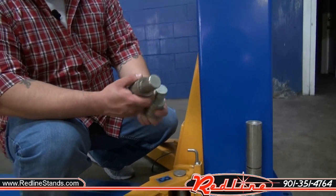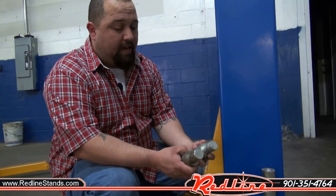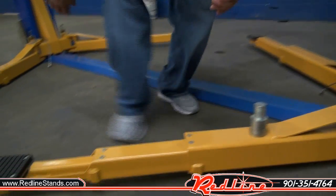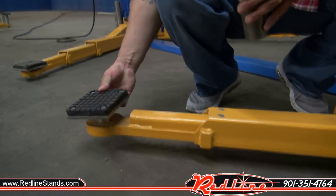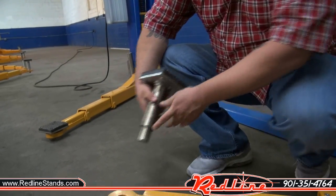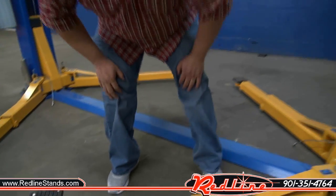These are great for if you have a truck whose frame is higher than the bottom of your cab. These will set up in your pad such as this — you lift your pad off the arm, set your pad in the adapter, and drop your adapter into the arm like so.